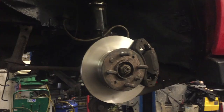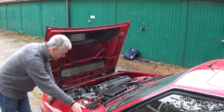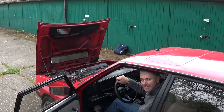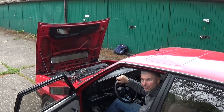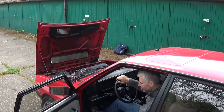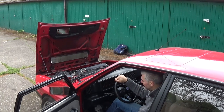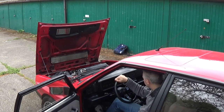With this Delta the brakes had to be redone — make sure you've budgeted for that. They're not expensive but generally speaking you're going to lose a few hundred pounds if you have to redo the brakes all around with pads, discs, and brake master cylinder. If you get any slippage or if the pedal feels quite wooden, you're looking at a new clutch. If it's juddery or slips, look at it. On this car it does judder very slightly on pickup — I asked Auto Integrale and they think it's a competition clutch, which to them felt fine.